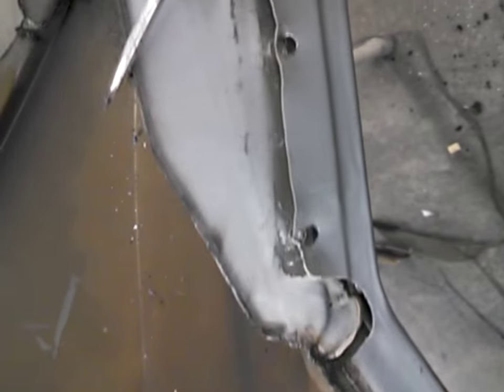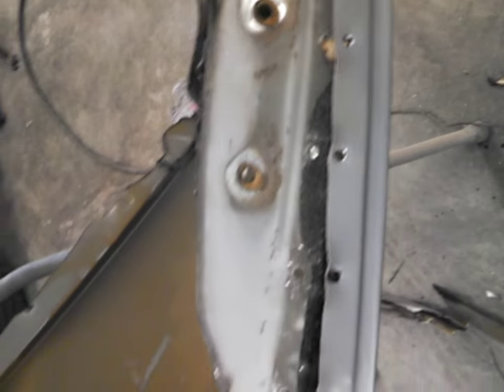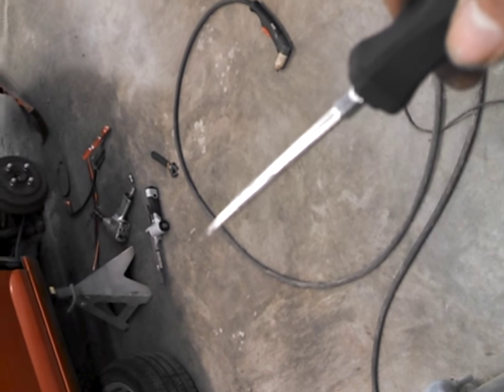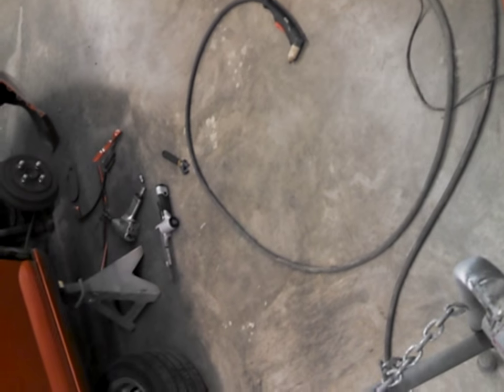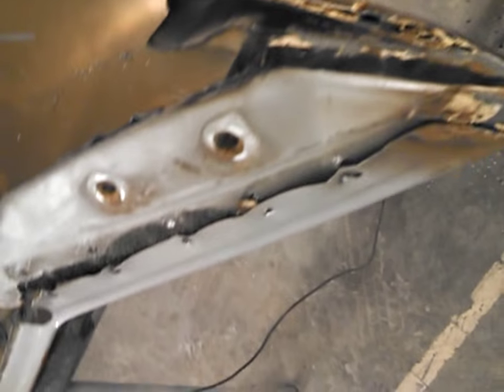Alright, part two. This is a panel — you can see I've already drilled out the spot welds on here, same as the typical way of doing it. This is my donor panel for that vehicle. The first part of the video showed you how to use the Onyx 3037 air belt sander for the old panel. The second half is drilling out all the spot welds on the donor panel — done on both sides.